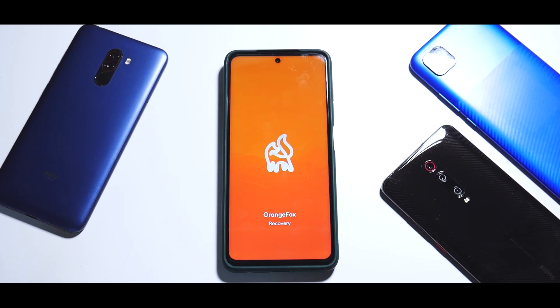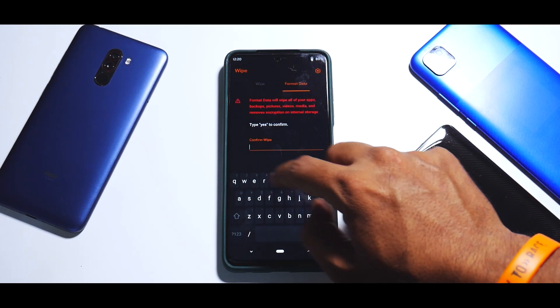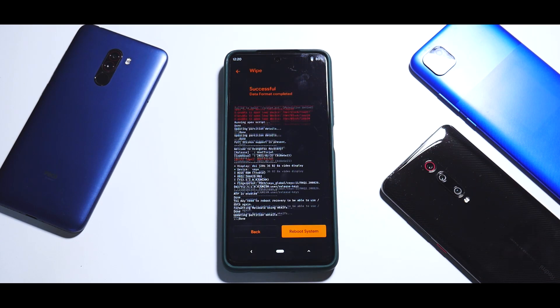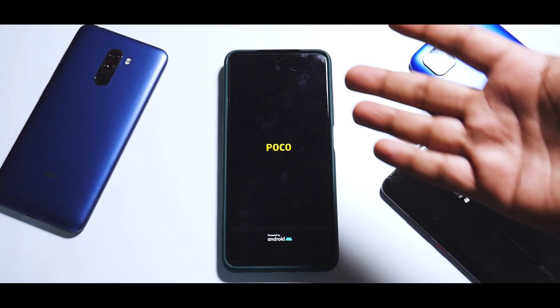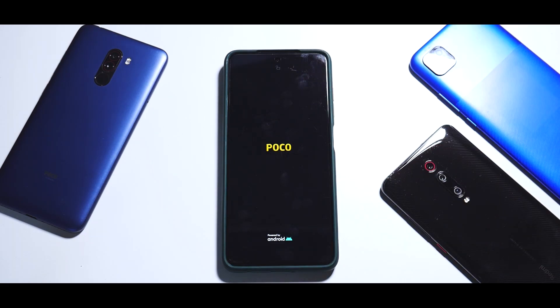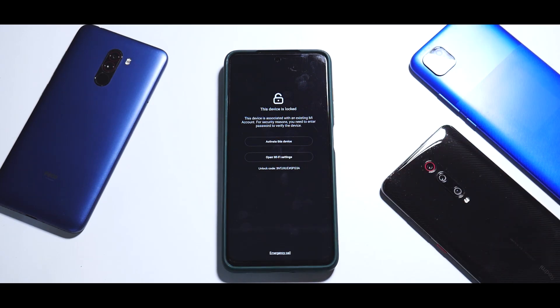Go to the menu, select Reboot, and select Recovery — because we have successfully flashed the ROM and Magisk version 23. In all probability this will definitely boot, because that is how it booted for me in the first go. Now that you have rebooted back into Orange Fox recovery, go to Wipe, then Format Data, type in 'yes', and then Reboot System. MIUI ROMs are notorious for taking time on the first boot — I'm expecting this will take anywhere between two to three minutes.